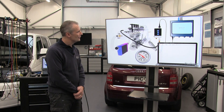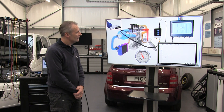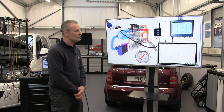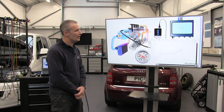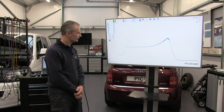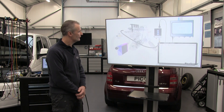Tap into the intake manifold and looking at a good vehicle, we are at wide open throttle. As the turbo speed increases so does the pressure, and there we see a peak above atmospheric pressure. So that's a good vehicle result.